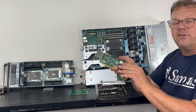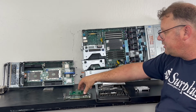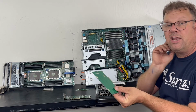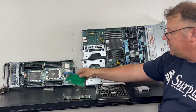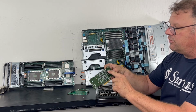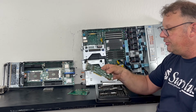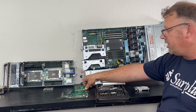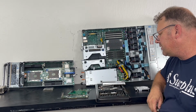You've got some of the different adapters, like this is the Boss card from Dell. Not much different than this Super Chinese card right here. Do you really need any more components than this? Well, Dell thinks they need a capacitor, a noise choke, some more resistors over here, and a couple little ICs to transfer SATA mode through it. Not really complicated. Some people think you don't need any components at all. Difference in simplicity of design.